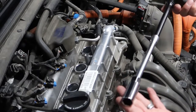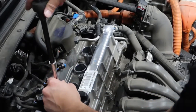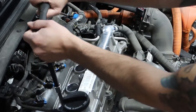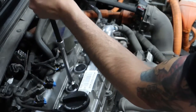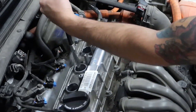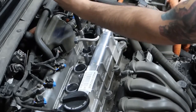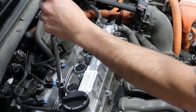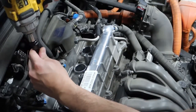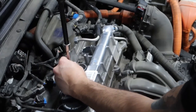So I'm going to use a double extension and my spark plug socket — you can just get one long extension. I'm going to put it in there and then you want to brace it. This is tight — break it loose. I like to break each one loose and then take it out. Get it broken relatively loose, and then I can go in there. Now that it's broken, just put it in there and there we go. We'll go ahead and do that on each.